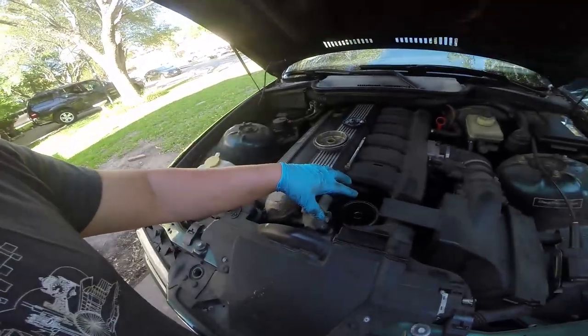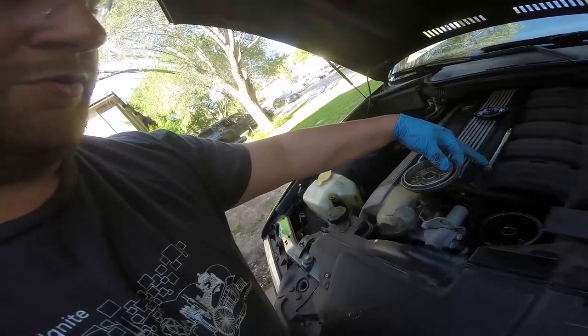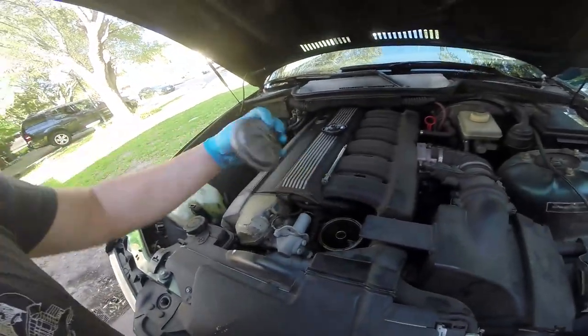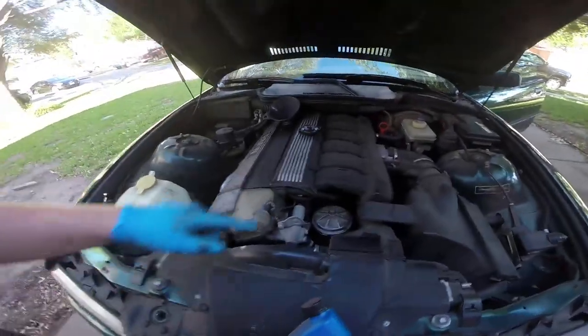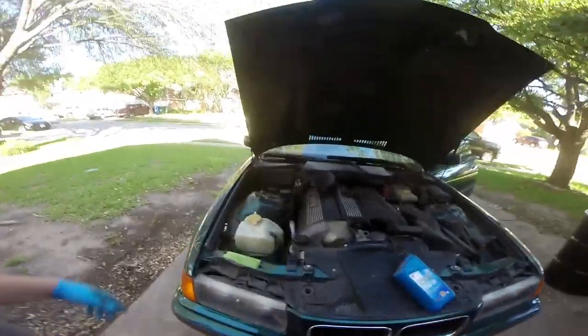So that's where the filter came out of. The new filter will go in there, and the kit also comes with a new crush washer for this bolt right here and a new o-ring for this cap, so we'll replace those first. Once you've snugged the top — I'm sure it has a torque spec, probably like 15 pounds — and snugged the bolt at the bottom, last thing is to put six quarts of fresh oil in and fire it up.